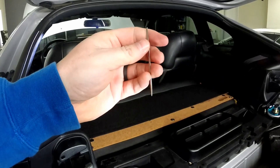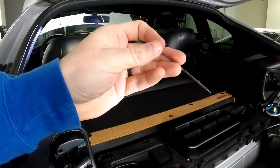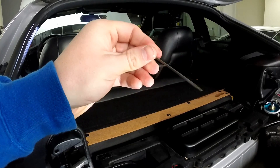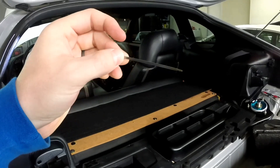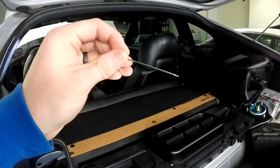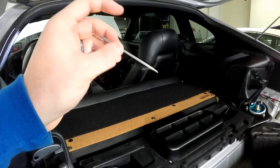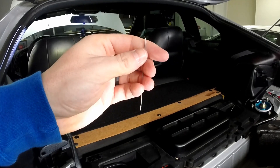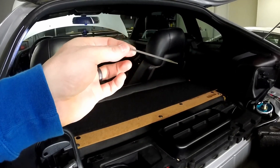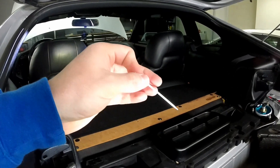This little tool here — it's part of a windshield wiper. I learned this from my grandfather back in the day when he was de-pinning stuff on Chevy Camaros in the late 80s, early 90s. You just cut off a piece of an old windshield wiper, cut it down, file it down, and it works perfectly to fit in there to de-pin old plugs. I've seen tools specifically for this but this has worked great. You can buy a cheap windshield wiper for seven or eight bucks, cut a couple pieces out, grind down an edge, and you're good to go.